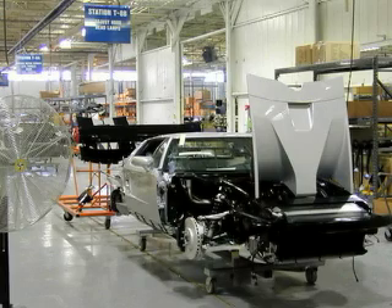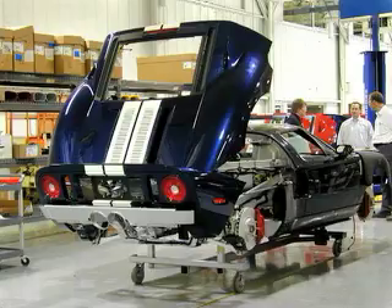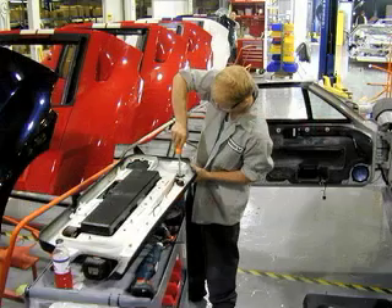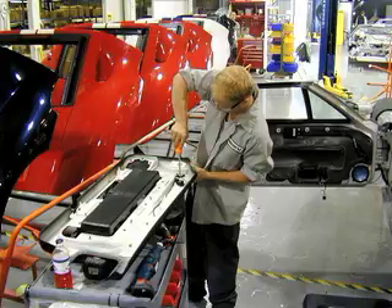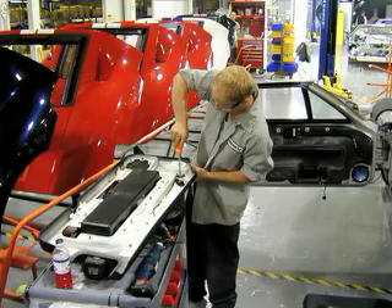The front and rear fascias are also installed, as are the hood and headlights. The rear hatch and associated weather stripping, along with the secondary door seals and the quarter panels, are locked into position. Panel gaps are confirmed before the side scoops are installed using a combination of plastic and metal fasteners. The door panels, sound system amplifier, and the switches for the door locks and windows go in next. Tweeters are installed in cars with the upgraded sound system, which means an extra hole must be cut in the door panel. Wiper blades and arms, along with the wheels and tires, are also installed.